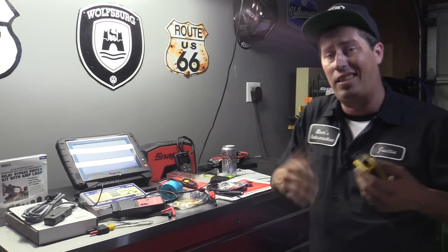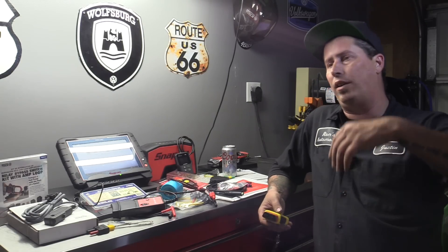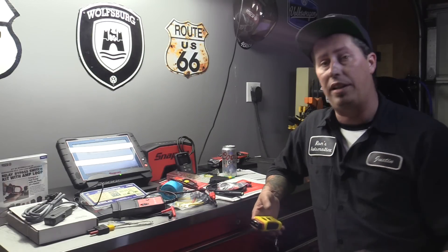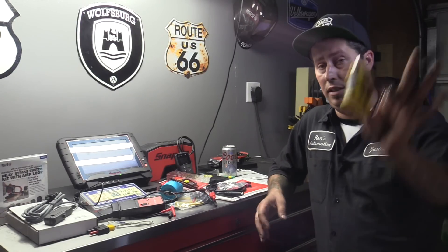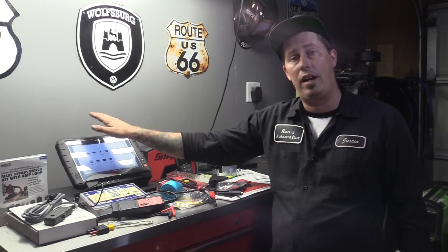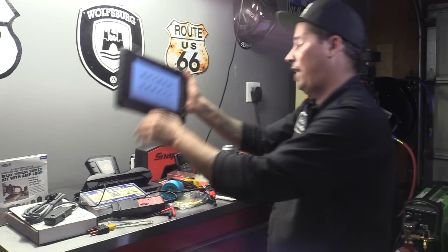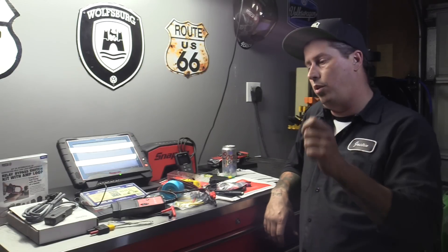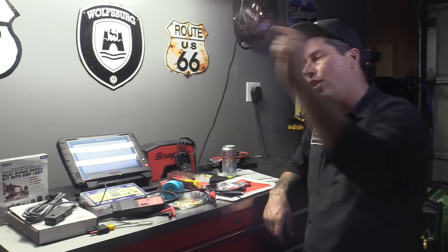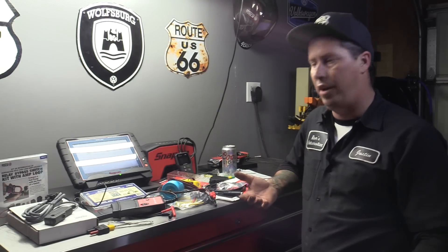Because I don't know how often I'm going to use this — how long I need the screen open using it on a car and so forth. When you plug the dongle in, unlike the Direct Connect Apollo, unlike the Triton, unlike the Solus Edge or the Ethos Pro — those ones if you plug them into the DLC connector, they charge the scan tool. This being a tablet with a dongle, it's all run off its own battery attached to the back of the scan tool. So it does die, and when it does, obviously you need a way to charge it. I just think it would be wildly beneficial to have the option for an additional cable with the docking station. Again, you're spending $375 for the dock — give a man a cable to plug into it.